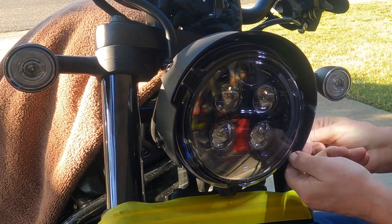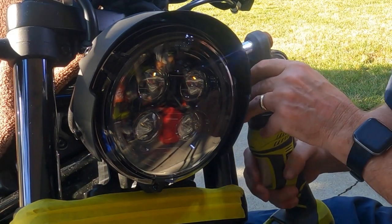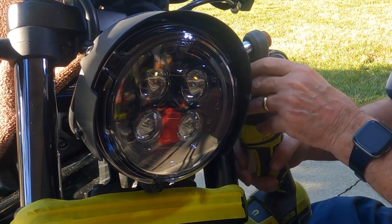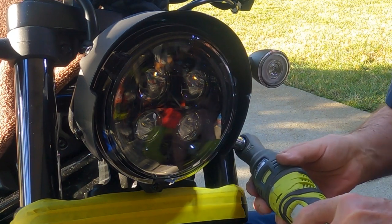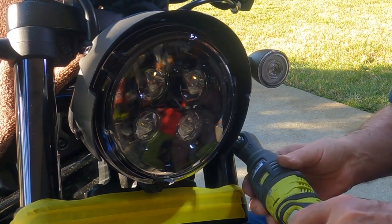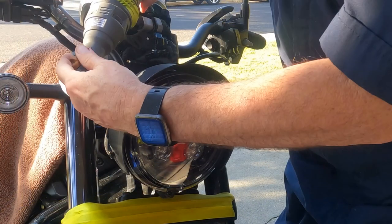A dental torque wrench might be accurate at 3/4 of a foot-pound. I checked out the theory with my stepson-in-law, who's a periodontist. But that didn't pan out either. His torque tool maxes out at 0.4 newton meters, just a bit under half of the Honda specified torque. I would never ask to use his dental tool anyway. He wouldn't want to put it in a patient's mouth after I've used it to torque bolts on my motorcycle.